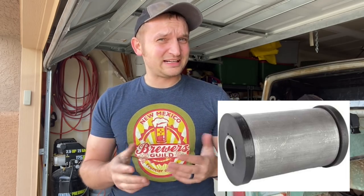Your next style of joint is what they call a Johnny joint or a flex joint, which is a ball inside your joint housing. The ball has two openings on the end so the bolt can go through it, surrounded by a rubber bushing. That allows a lot more flex because the joint can move freely with some resistance, and the rubber around the joint helps with vibration damping to give you a much smoother ride when driving on-road. They're great for daily drivers. They do require maintenance and routine greasing, whereas your standard OEM style joint doesn't typically require any greasing.